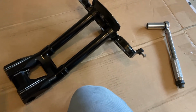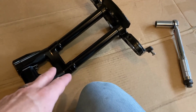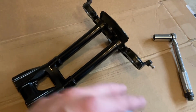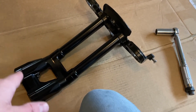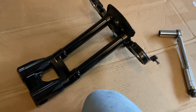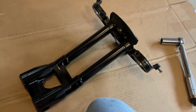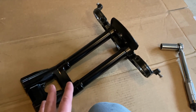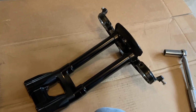I'm going to mount this back onto the triple tree, and then we'll switch gears. Like I said before, I'll start fishing that wire out of the bars. We'll run them through the Fly Moto once this is mounted, and then we'll pull the top clamp off the riser, and then we'll mount them up. We'll hook in the controls and the grips, and that'll probably be it for today. After that, I'll talk about the next video. All right, so stay tuned.